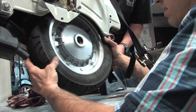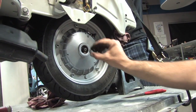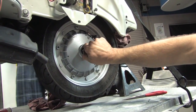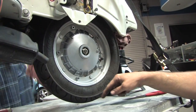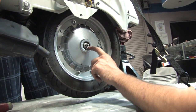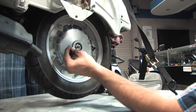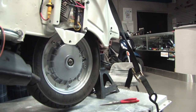There's a cutout on the back of the frame so you can get the wheel in easier. Put the washer and nut on — right now I'm not going to bother tightening it. Once I have the tire down on the table I'll torque it to around 80 foot-pounds, but it's pretty much give or take where you line up one of the slots so you can put the cotter pin through. I'll do that a little bit later and pop the little cap on.